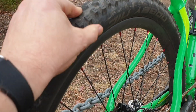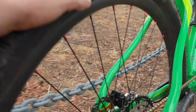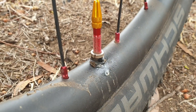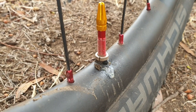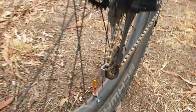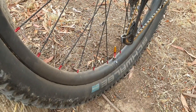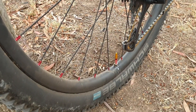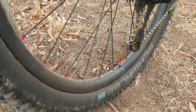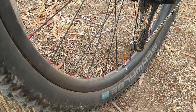You can see here I put about 50 psi in this tyre about 20 minutes ago and it's gone — you can actually see it bubbling out there. We've not been able to stop that. We've put on some extra rubber washers and tried most things. It's almost like it's too small for the valve hole itself. So those will be coming out and a set of good high quality valves will be going in.